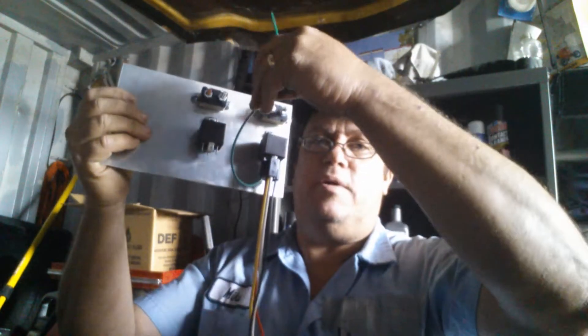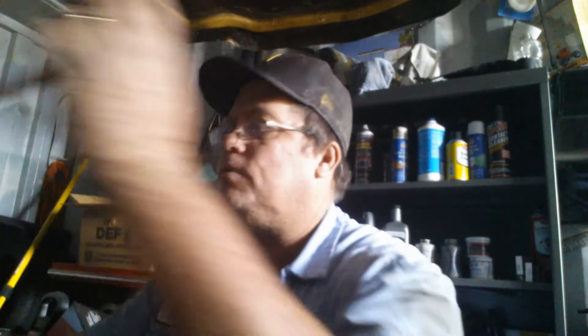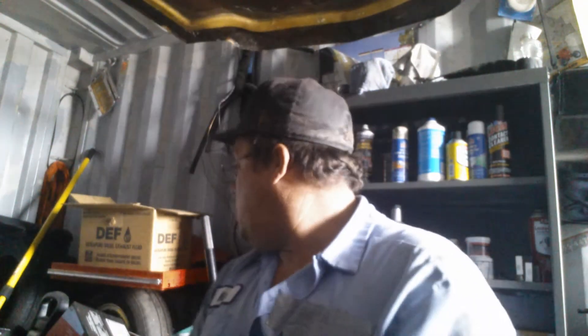You're going to have to make it nice and pretty all together and I don't know if I'm going to be able to make it look as good as I want. I got all the relays, the circuit breakers, the pigtails, along with the temperature switch — it was all about $70. Now you can go buy a kit to do this from places like Summit or JEGS for about $70 or $80, but everybody claims that all the relays and stuff in those kits is garbage. So that's why I'm doing my own setup.